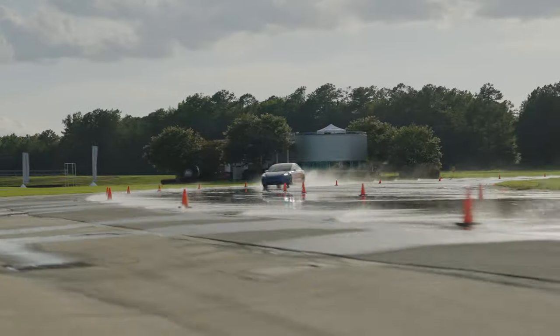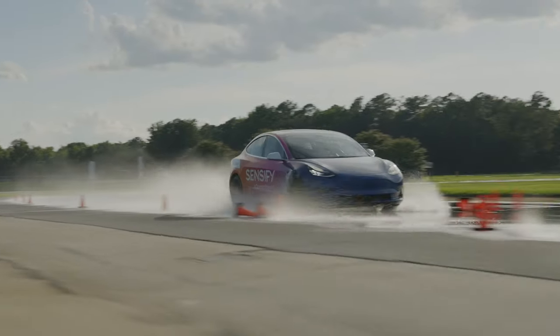When you hit the brakes, we can tell based on how much slip is created with the amount of pressure whether we're on a low mu, high mu, or medium mu situation — and we use a different parameter set for each. For non-technical people, mu is the grip of the surface, so ice would be a low mu. If we sense that you're on ice, we're going to use very different parameters than if we sense you're on high mu asphalt. And it picks up on that pretty quickly. Right now we're on wet surfaces so we've been using all of our medium mu parameters.